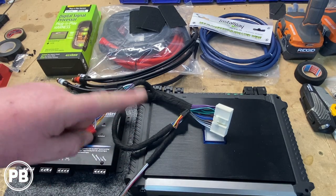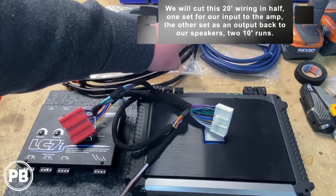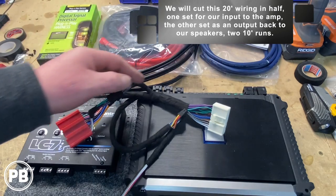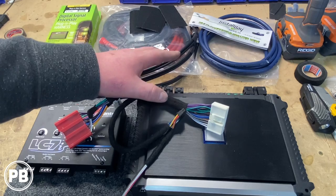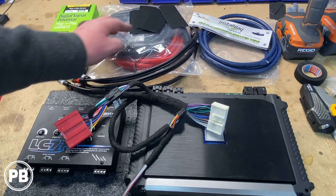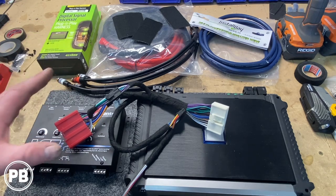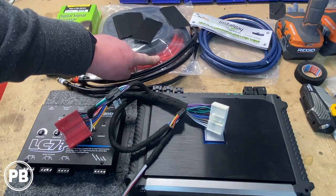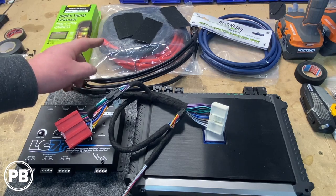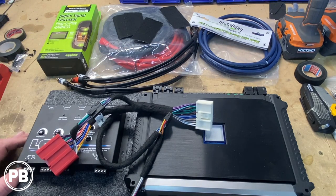To send that signal to and from our amplifier area, we have a 20-foot, 9-wire conductor cable — 18-gauge copper by InstallBay, technically Metra — with all our wiring for inputs and outputs. We have an OFC 4-gauge amplifier wiring kit and some Velcro straps so the board Velcros to the carpet in the trunk and won't go anywhere. Let's start running our power wire from the battery area under the hood, through the firewall to the trunk, and prepping our 9-conductor cable and T-harness.